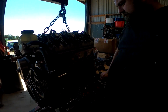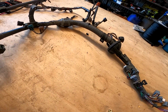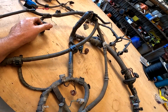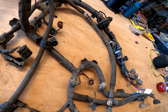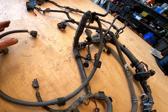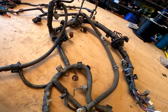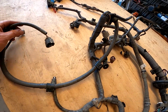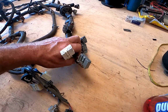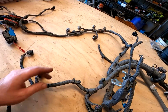The start wire. So what we do is we take this, and I'm going to sit over the other side and map this out for Jace. This is the gearbox side. Where's the gearbox? Alternator comes out. Here it is. So the gearbox loom, we'll cut up in here somewhere and put a plug on it. That'll be wired into the Link for the speedo. This stuff gets recreated and stripped out. There's only a couple of wires we'll use, and these will plug in like standard. Real simple. I'll map that for you.